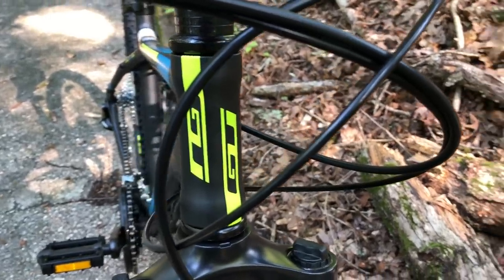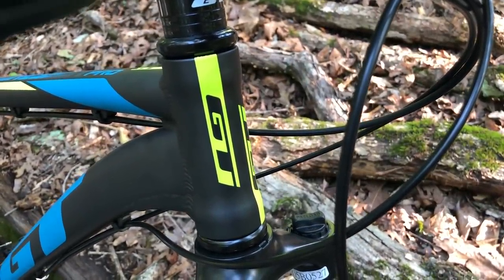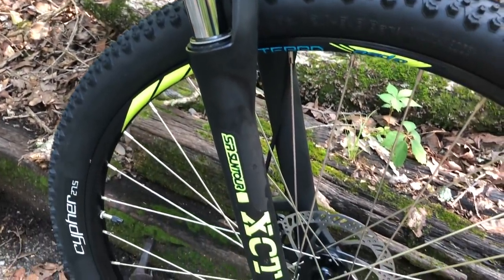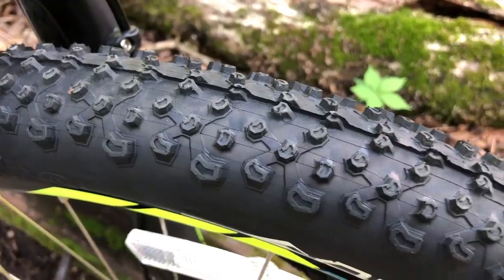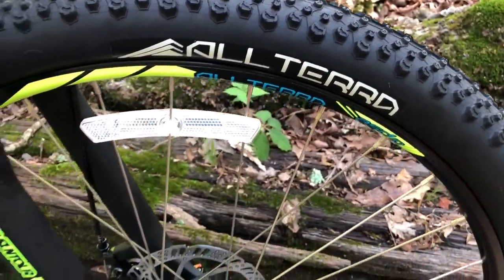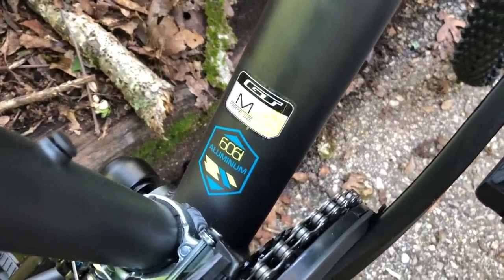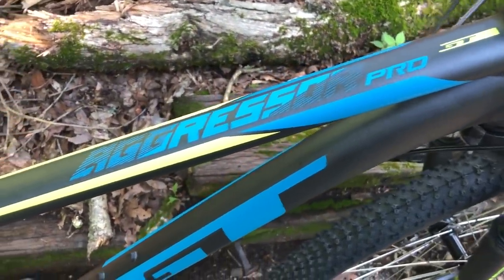The Aggressor Pro does have one knock on it, and that's that it doesn't have a tapered headset. But for $299, it gets a pass, because based on the overall package you do get a few brand name components, like the SR Suntour XCT4. And while it only has 80mm of travel, at least it's not the Zoom fork we normally see on a $299 bike from somewhere like Walmart. The 27.5x2.10 tires are branded Altera, but in reality they're actually Duro. The rims, also branded Altera, are alloy double wall. The frame is 6061 aluminum alloy, matte black with blue and neon yellow accents.